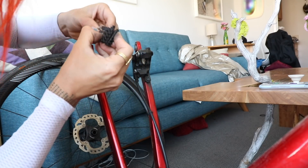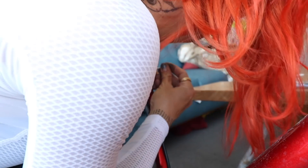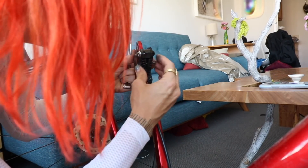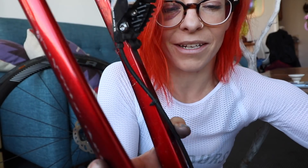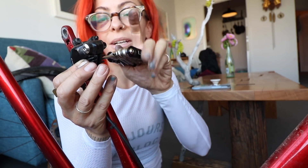I push this little baby against it. Now that I've taken care of the rotors, I'm going to slide these pads back in — they go from back to front on my bike. There's a little hole and I have to make sure the pin can go through, so I've got to make sure this is all lined up. I think they're in place — let's put this pin in and hope for the best. There's a little metal piece in there, it's not quite lining up. I'm going to use the trusty butter knife again — and it worked!